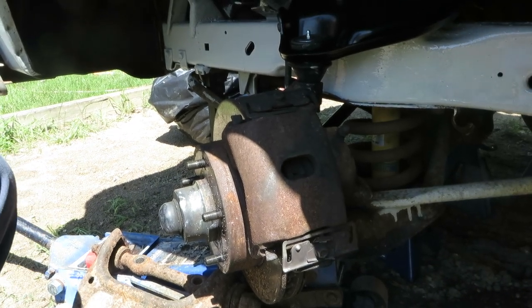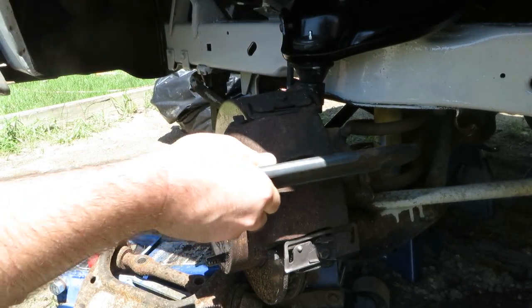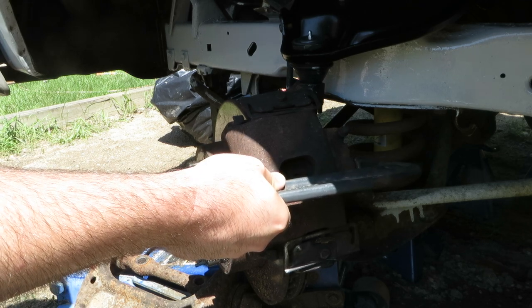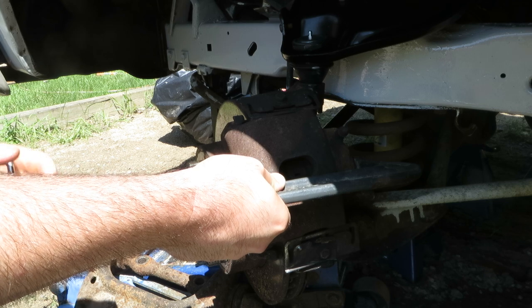All right, so we just compress the piston quickly. Usually you can just kind of jiggle things around a bit, but don't go too far if you're going to do this because it could overflow your master cylinder.